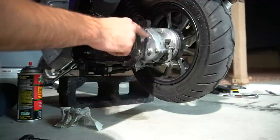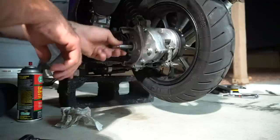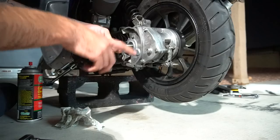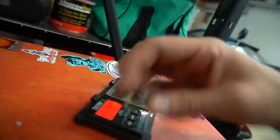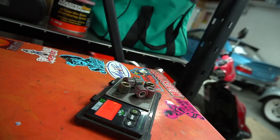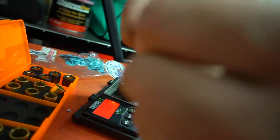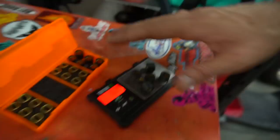It will spin freely after you put everything back on. If your case is rubbing on something on the inside, it's probably something to do with your gear not sliding all the way on your axle. On Cole's we had to not run that washer, but this one runs with washers. If you don't know your gearing, you can count it by spinning this and marking it — watch how many times your wheel spins. This should spin seven times for every one wheel rotation. Now we can throw all the CVT stuff back on and put in my new rollers. Total weight was 32 grams last time — going to aim for 36, which I think is what Chuck's running. One shell out of the whole pack was the complete wrong size, so I just took one off my other bike. Sitting at 36 grams now.